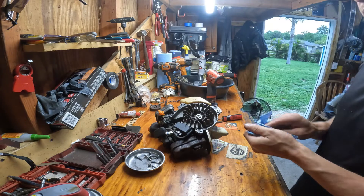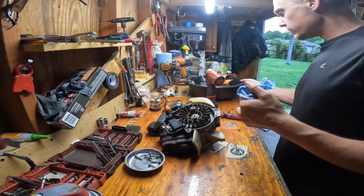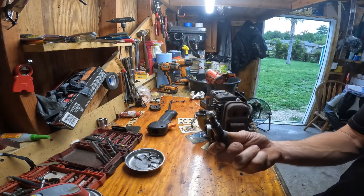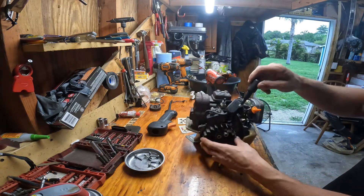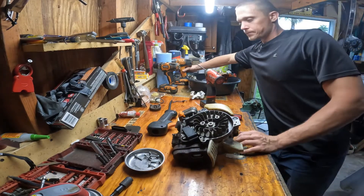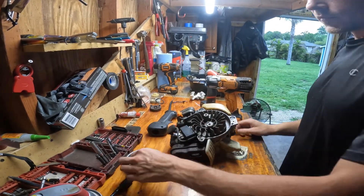So far it's been a T27 and a T25. Now we're going to take the flywheel off. Stihl makes a special piston locking tool — you take the spark plug out, thread it in there, and it allows you to lock the flywheel. That's not necessary if you don't want to go buy a tool. To get this off you're going to need an impact — this is a 13 millimeter or half inch. All you technicians, please look away. Just like that, comes right off.